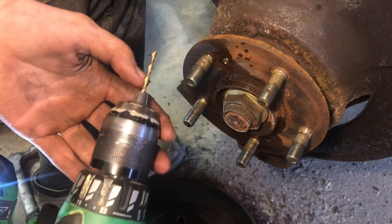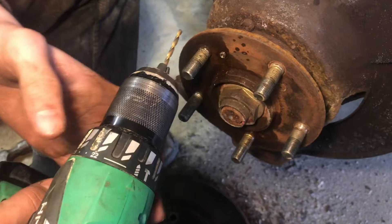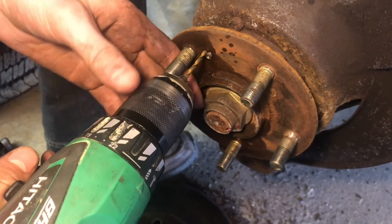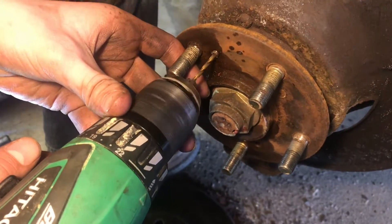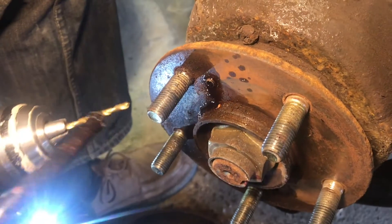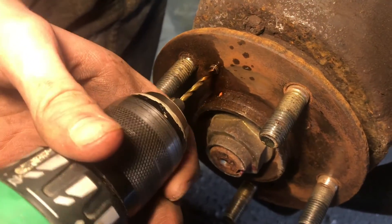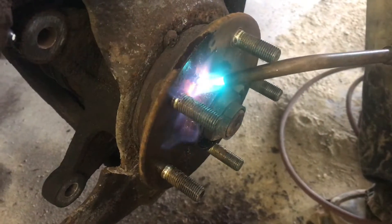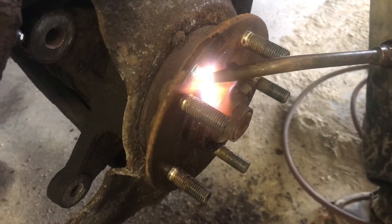If you're going to have a lot of drill bits, make sure you've got a pile of 1/8-inch bits because they seem to break all the time — they're one of the most common, used for pop rivets and different things including this. So this bolt is hardened steel and we can't drill through it.